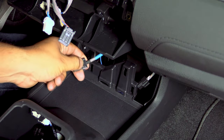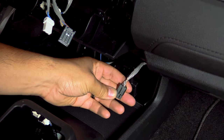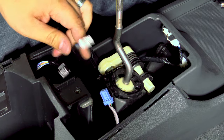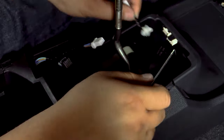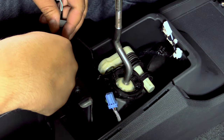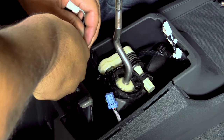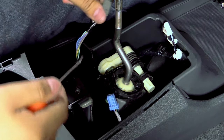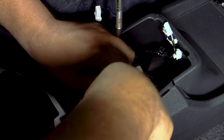As for the connectors, it's pretty straightforward — there are simple release buttons on the back and on the side of the power outlet. Next we need to remove all the mounting clips holding the harness to the panels. It can get a little tricky — you can use picks, pry bars, or just a knife or pliers to cut them. You won't really need them in the future; they're mainly there to help during assembly of the car. After these installs we ran the car without them and there are no real noises or rattles that are apparent when driving.